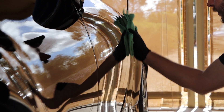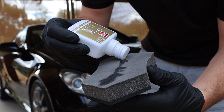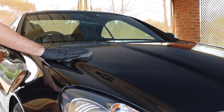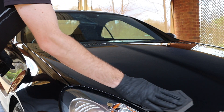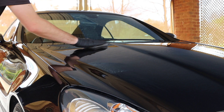Once this process was completed, I pulled out the ceramic coating bottle, gave it a shake, then poured a line down the applicator pad. Gently, I worked over sections of a panel at a time, using minimal pressure — only enough to press the pad down evenly across onto the paint. I overlapped and cross-hatched, making sure to work in straight motions again, and ensured that the space I was working on was evenly and completely covered.